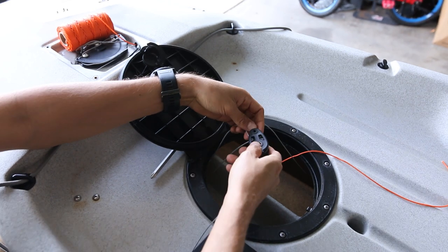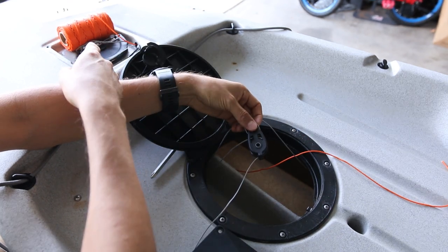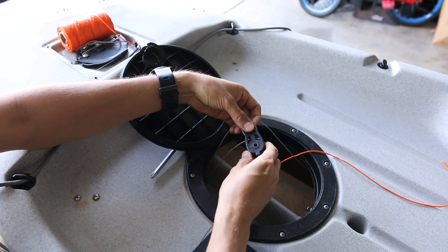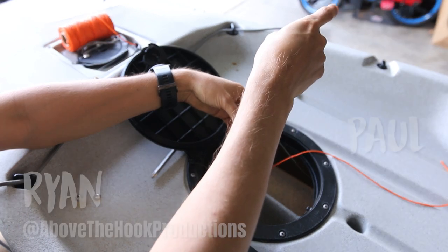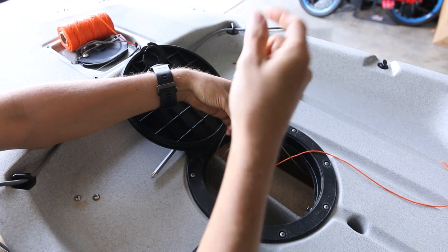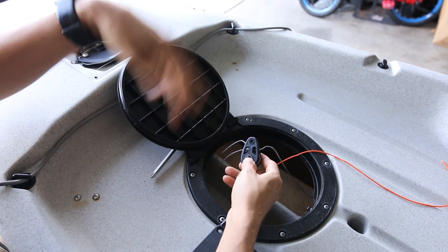That line is fine. It's just part of the way it's set up so that when you turn your rudder handle to the left, your rudder actually turns to the left. So it's counter steering. If you're on a sailboat with a normal rudder, if you want to go left, you steer right. If you want to go right, you steer left. But on a Hobie, if you steer right, you go right. If you steer left, you go left. So that's how that's being done with different pulleys.